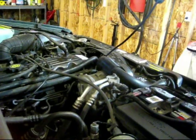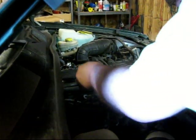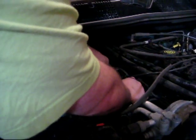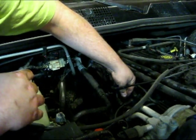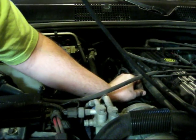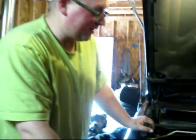So then I've got to route this wire in here. This one kind of gets looped under and around. I'll go under here, just push this onto the distributor. You can kind of hear that snap — when you get it seated properly you can feel it click on. Then I'll just push it on the plug. This goes on real easy, and you can just kind of feel the snap. You'll probably know right away if you don't get them seated properly, because one of your cylinders won't be firing.